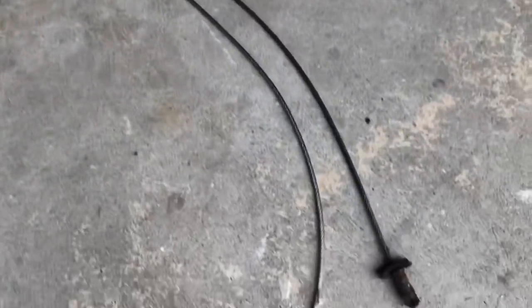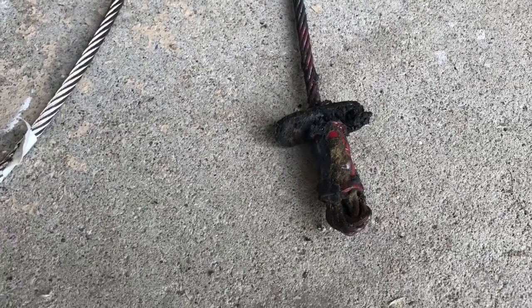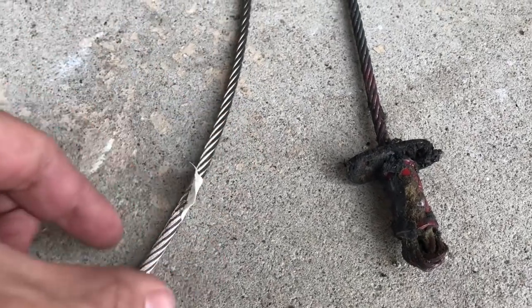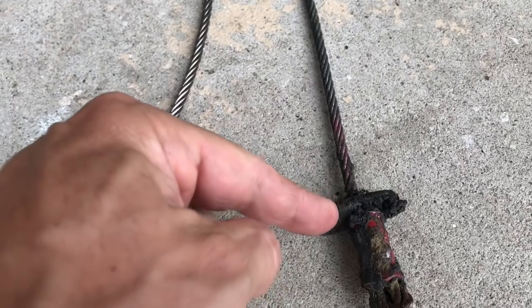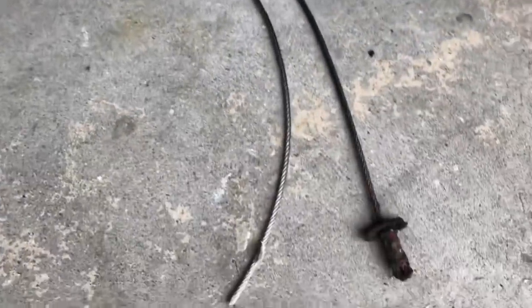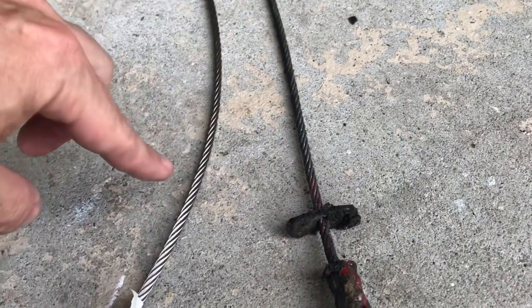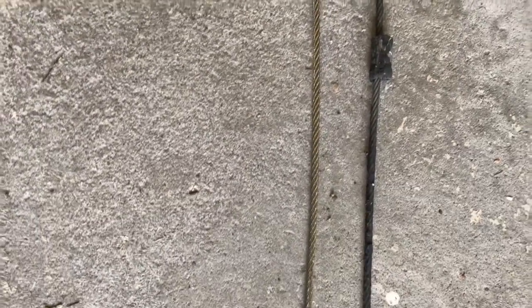The first thing we're going to need to do is crimp the end. As you can see, the crimp used by Goshen is just your typical end-stop sleeve — a dual-entry crimp connector. You put the crimp connector on, bend the cable around, feed it back into the other part of the crimp connector, and crimp it. That gets your stop. You want to make sure you slide the metal bracket pusher onto the new cable before we put the middle crimp on, because once the middle crimp is on, you won't be able to get that stopper through and slide it over.